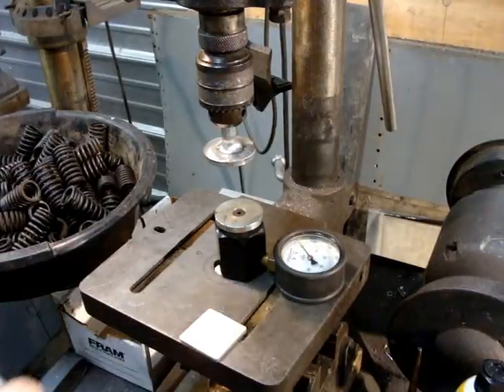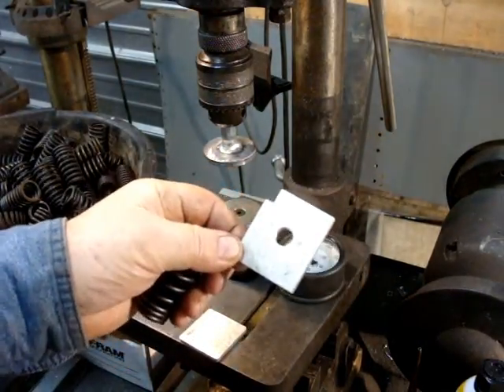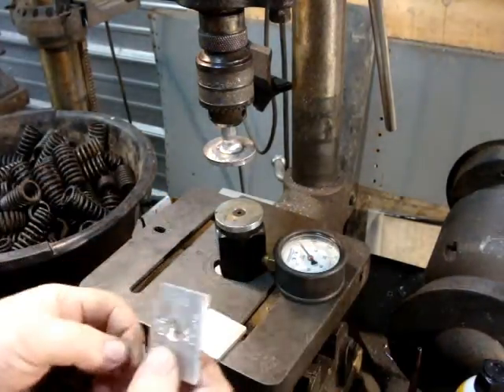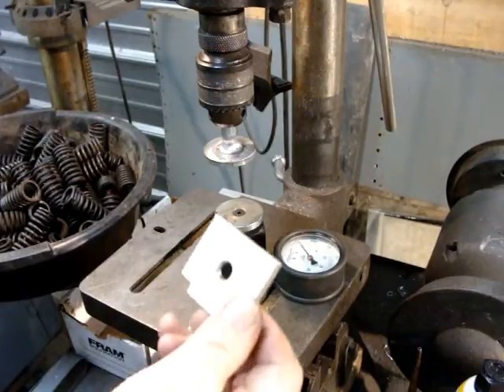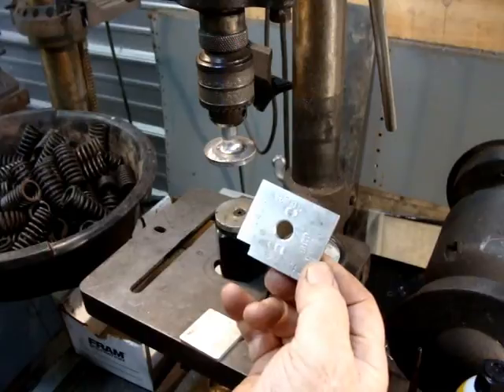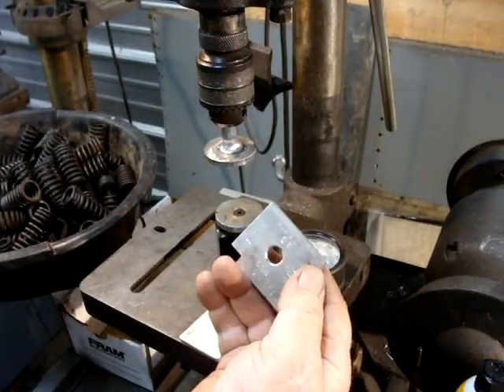What was interesting was making this little checker piece. This has got different dimensions on it — each side is a different length, and each side corresponds to the specs for an R2 valve spring. So this is all for the VL220 R2 valve spring setups.